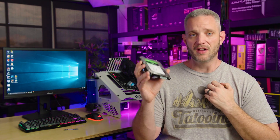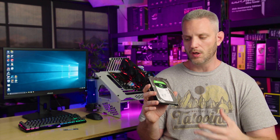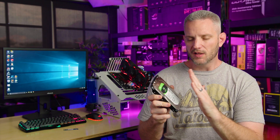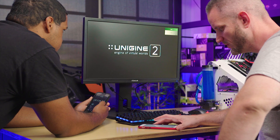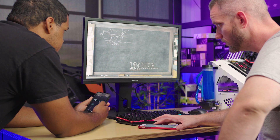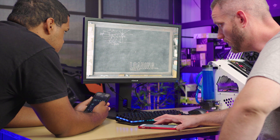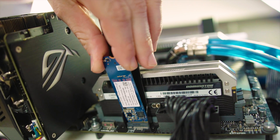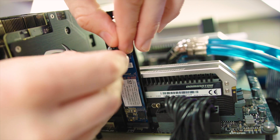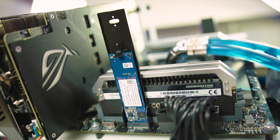We benchmarked three different scenarios. First, just the hard drive — where a lot of people start off. I'm taking the perspective of someone on a low budget with an existing hard drive that already has an OS on it, who doesn't want to spend more money and start all over. We benchmarked the hard drive with a cloned copy of the SSD operating system drive from my test bench — about a year's worth of registry and files cloned onto it, not a fresh install. Then we installed the Optane memory using the installation guides linked in the description, got it going, and compared the results.